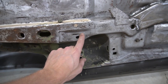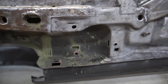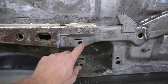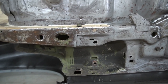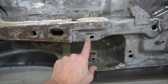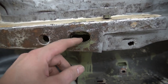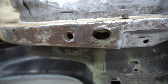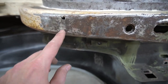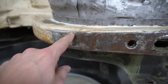So now we're looking at the bottom torque box, and this is where your leaf spring bucket gets bolted in at. What I have here is a tear across here and then down, and then there's a hole on the other side. It's not a rust hole, it's a square hole — I don't know if you can see it, it's meant to be there. But anyway, this tore the whole way across here and it seems pretty thick. I don't know if someone was doing too many burnouts or what, but I can definitely weld this all together. I just kind of want to inspect this and see what's going on. Hopefully it's not due to thin metal. You can see sort of the same thing as up top — we have swollen metal in here. Back here, I found another little thin spot, but once we go up, everything gets better.